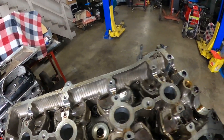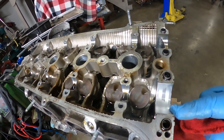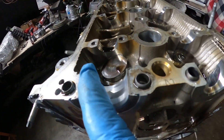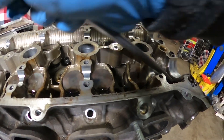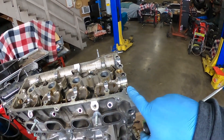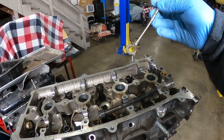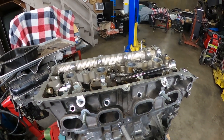I'm gonna remove the head bolts. There's a head bolt under this bearing — I'm gonna take the bearing off first. It looks like there's a little bit of wear on this side of the bearing. I'll grab my socket and break all the bolts loose. I got all the head bolts loose, so now I'm taking them off — using a magnet makes it a lot easier. You've got to remove the head bolt and the washer together.